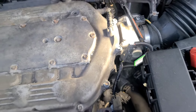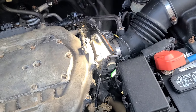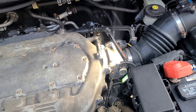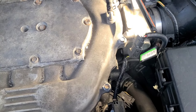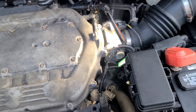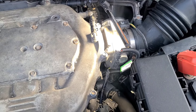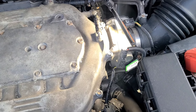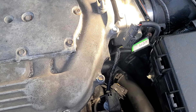That's pretty much all you're going to have to do. Then you're going to monitor your vehicle and make sure the eco light doesn't come back on, so you can have all your pistons running like they should — six cylinders. They say it also helps prevent sludge buildup and some other things, just because the pistons aren't moving and not getting as much function as the rest. Hopefully this helps you out on the VCM muzzler install.